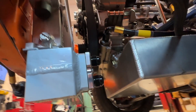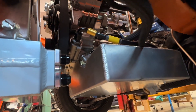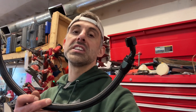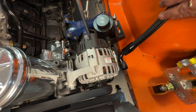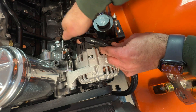Installing these is very straightforward and there is an order of installation that you need to follow. We need to be careful not to put them in backwards or else air will get trapped in the system. So here's what we've got: an AN10 line with a 45 on one side and a 90 on the other side and a 45 on this side. That's the perfect fittings and perfect length in order to get this thing installed. I did one line and half of the other line, but I want to explain how AN10 lines typically should be assembled and installed. The key here is that you clock these correctly when you're assembling them — that really is so, so important.